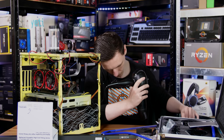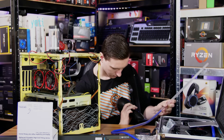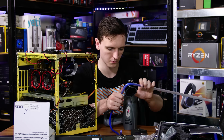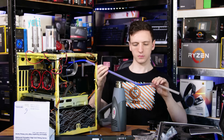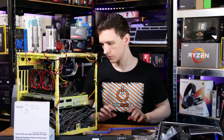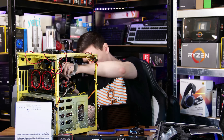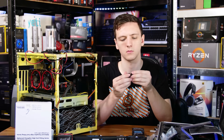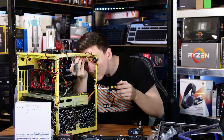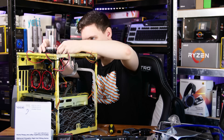I was trying to bend the tubing with a hairdryer — I thought this would be hot enough, but that didn't really work out. So I went and bought a heat gun, which worked perfectly fine. In fact, it worked so well that I burnt my thumb really badly. So this is the next day where we're bending the tubing, just trying to get everything in place. The first one is from the radiator to the inlet of the pump, then the outlet of the pump to the CPU block, and then the CPU block to the radiator. I'm going to leave you with this time-lapse and some nice music while we're cutting everything up and getting everything ready.